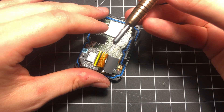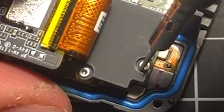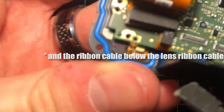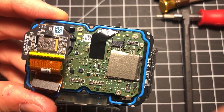We still have two more ribbon cables to remove, but to get to them we have to remove this gray door that sits below the lens sensor. I would strongly recommend using a small flathead screwdriver to get those screws up, because I couldn't find an exact fit Torx. Once you do that, take your plastic tool and you can get that lens sensor cable up. There is one right below it, off to the right — I apologize for the terrible photo, but I hope you can see where that final little ribbon cable is.